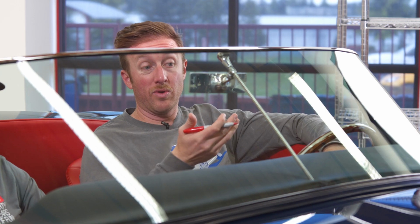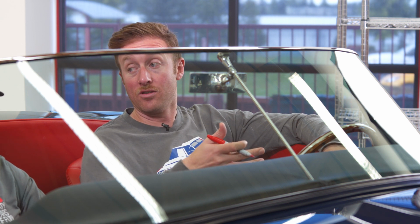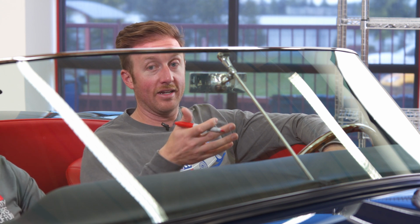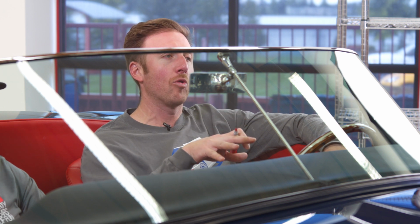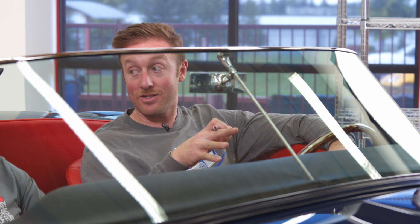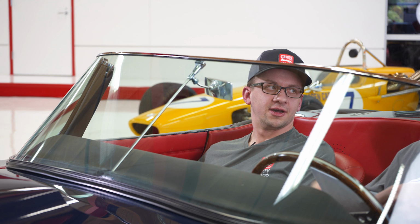But yeah, the other thing, we recommend putting iron and fallout on a dry car so you get maximum dwell. And so if the car is dry and you're using it as your standalone lubricant, to your point, you've got the drying risk, and just make sure you're using enough product. And then again, if you're wanting the iron and fallout to do its job, you've got to let it dwell for a little bit. And then if you started claying, you're most likely adding more product. But if the car's wet and you use iron and fallout as your lubricant, again, you're going to dilute the iron and fallout and not get its full potential before you start claying. So definitely some trade-offs to that one.